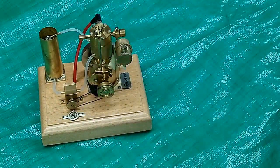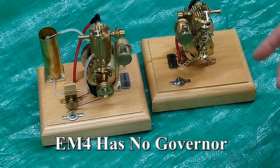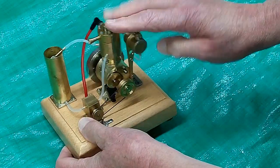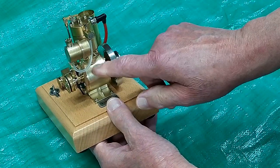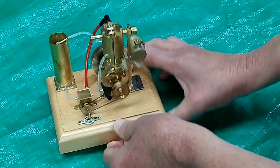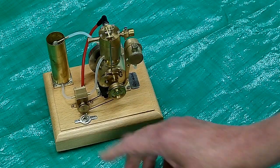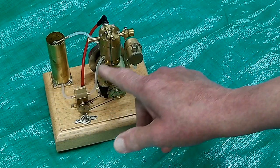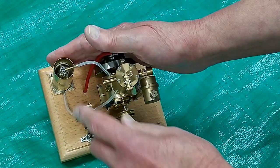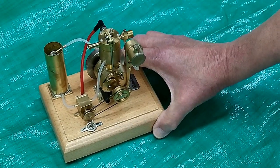This is essentially a water-cooled version of the EM2. It's not exactly the same. All of this is brass — most of this is brass. The crankcase appears to be cast aluminum, then anodized. This one is water-cooled; it has a gear pump. It takes water from this cooling tank, pumps it into the bottom of this cooling sleeve, and when the water comes out the top it goes into the tank. There's some screen wire in there to disperse the water, keep it from splashing, and help with the cooling.